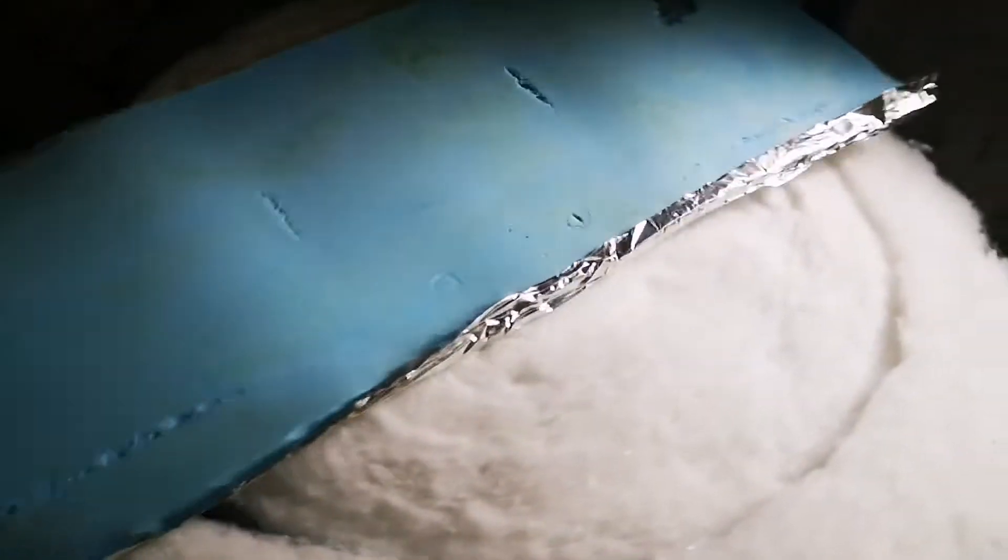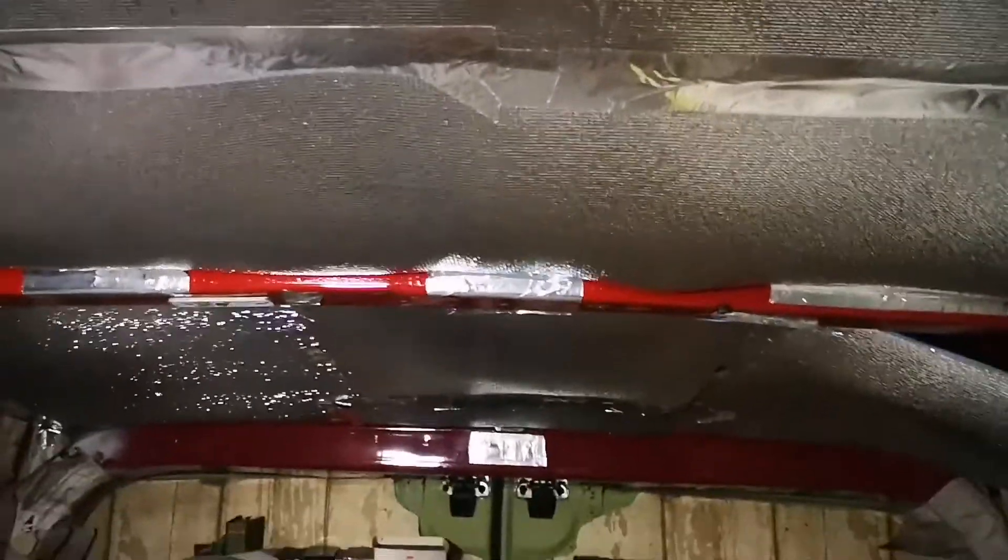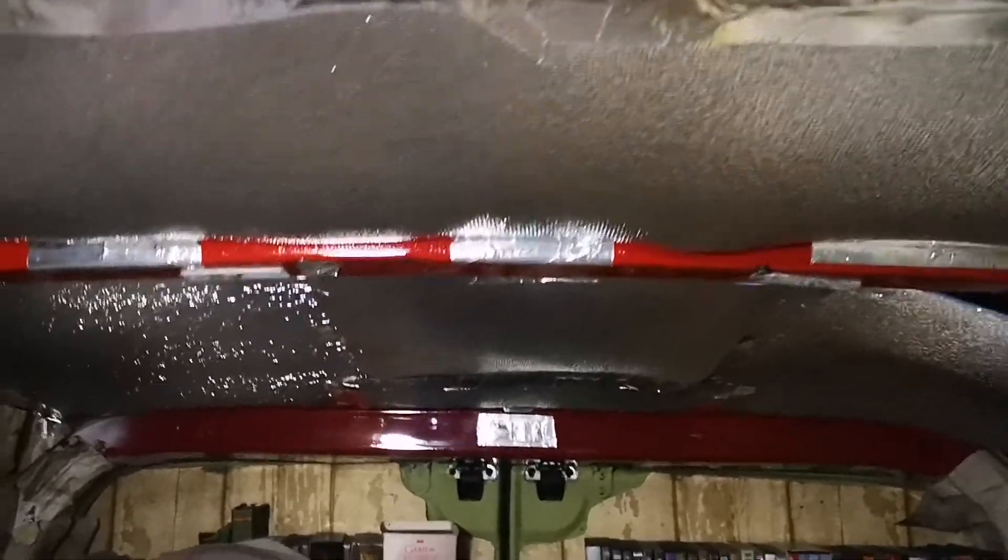It's okay as a vapor barrier, but that's an expensive way of doing it. What I've done is sound deadening. This is what I've used against the metal — six mil dense foam, cut panels out, stick it to the walls. The roof is fully covered in it. You can see that bit there that's dropped down. There's a section at the back in the middle that's going to come out because I've got a skylight to go in, so today I'm just insulating this section.